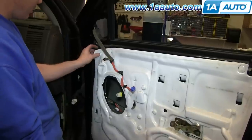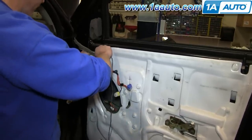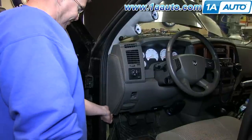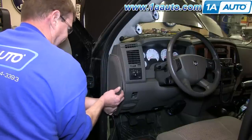Now slowly and carefully pull your water shield down. Be very careful not to tear it or rip it — you just need to pull the top corner down on each side. On the driver's side, you want to pull the side dash panel off: work your fingers in under the bottom and then slide them up and release the clips all the way around.